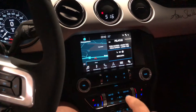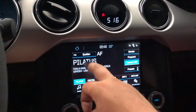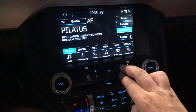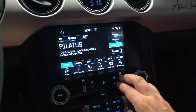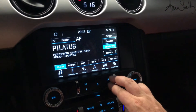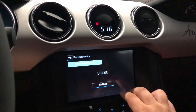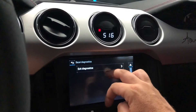What you need to know for the standard method: make sure you have an FM radio station set up, then press the eject button and the skip next — on other cars they're in different places, but here the eject button is just below the skip next. Press both and keep them pressed until the speaker walk-around test comes up, then press test and you can do all the things you already know.